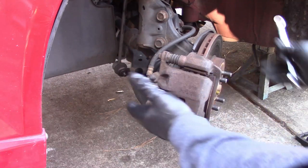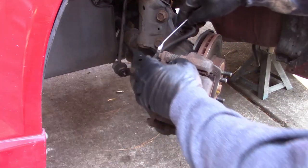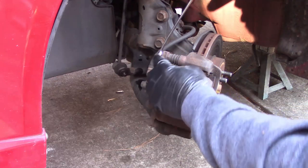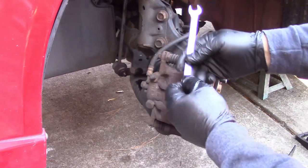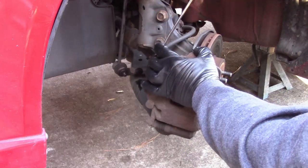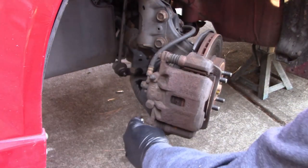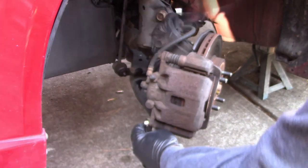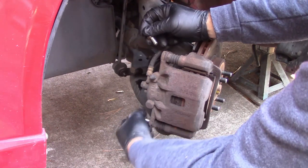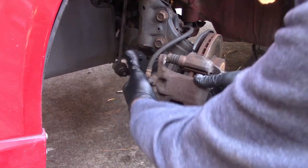Since this is such a small space on this car, I'm taking advantage of turning the wheel to the left so that the driver's side caliper is more exposed. I need to break loose the bolts that hold the caliper — there's one here and one here, both 12 millimeter. I usually use a mallet when I do this because I don't like to beat up on my hands.